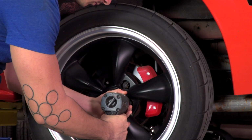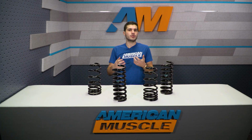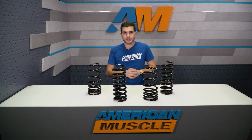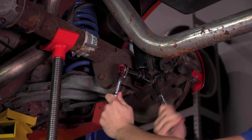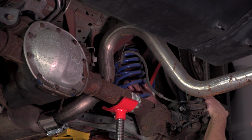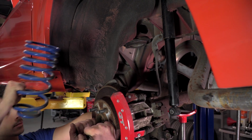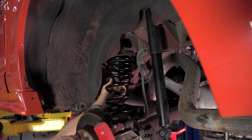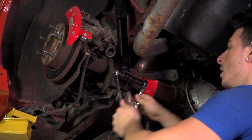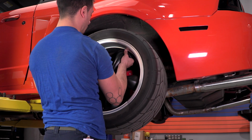All you'll have to do is jack up the car and of course remove one of those wheels. Now, at this point, you want to place a jack under the rear differential pumpkin and jack that up to relieve the pressure off the shock bolts. Once you take care of that, you can undo the bottom shock bolts, of course, and then slowly, and I mean slowly, lower down that pumpkin on that jack, and this will relieve the tension on the lowering spring in the back. Once that spring is out of place, you can put in the C-spring from Ford Performance into its place and redo that process in the opposite order, jacking up the differential, of course, rebolting that shock, putting the wheel back on, and dropping the car on the ground.